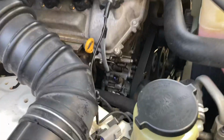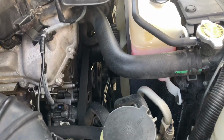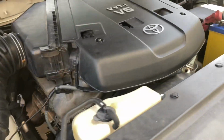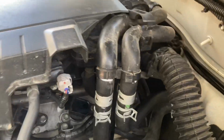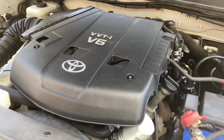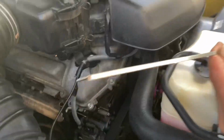But like I said, there's things we've got to do, like pull the dipstick out and have a look. Let's get that dipstick out and maybe just have a look if there's any staining on it. Grab a rag, mate, and let's just keep looking around. Look, no oil leaks, right? This is Mickey Mouse. Surely this engine would be fine and there's no issue with this. Yes, this is the one where all that rubbish was collected out of the sump and the oil pickup was blocked. So don't be misled by thinking, oh yeah, it looks pretty clean, whatever. I'll just come back around there and we'll have a look at that.